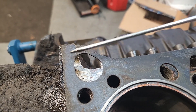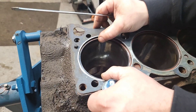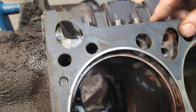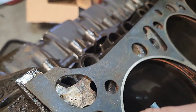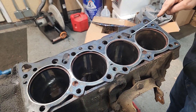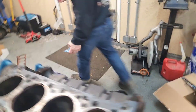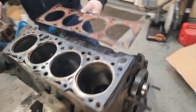There's one other area that is tricky — I call it the teardrop. In the 400-style head gasket, the oil return is a giant teardrop shape. But if you take it off the dowel pin and move it slightly, you expose the coolant window. It's barely covering it — real close. I've heard that Butler Performance's head gasket has a smaller teardrop giving a little more gasket surface there.